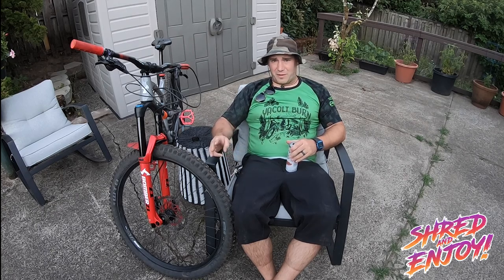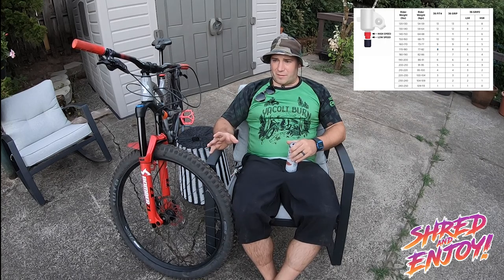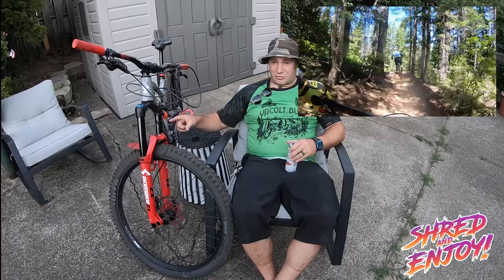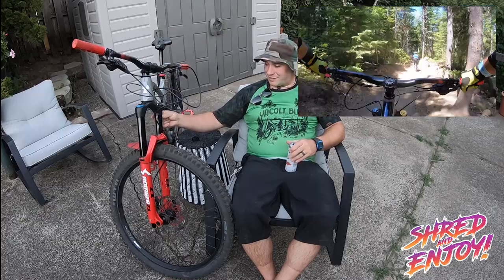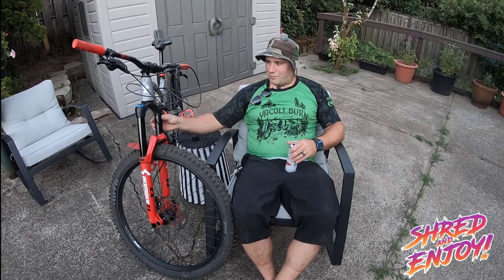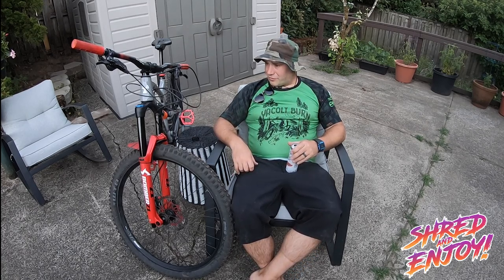How did it work? Where did I start? I began with the Fox 36/38 tuning guide — it gives baseline settings by weight. I'll be honest, they were pretty stiff. Out of the box, two steps in, I didn't like it. But there was some advantage: it wasn't blowing through all my travel. On some trails I would often max out the travel indicator. Switching over to Grip 2 at first I just wasn't feeling it, and I also wasn't really familiar with where I was riding.